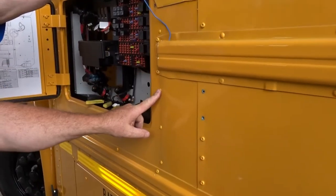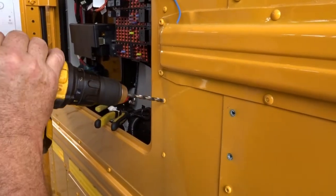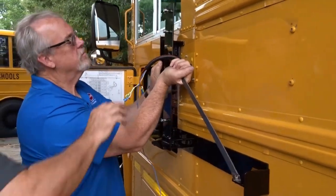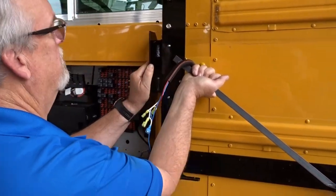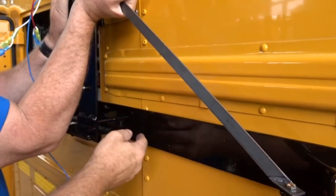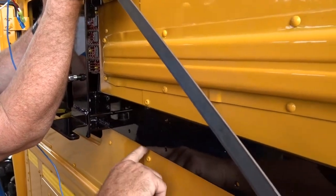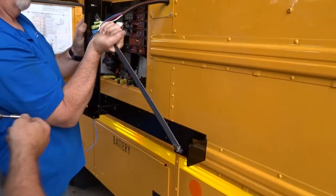With the rivet here, since that's going to be in the way, what you're going to do is drill the head of it out. All right, so we're going to use the two existing holes that were here from the original specialty box to set this. What you'll notice, though, at the bottom, this is not going to hit flat. It does have to be flat, so we're going to remove these two screws that are here. Two or three, we'll have to see what we've got. So if you pull that out, it's two. Okay. Let's go ahead and drop that down. We'll take those out, caulk them up.